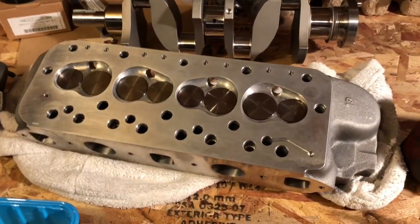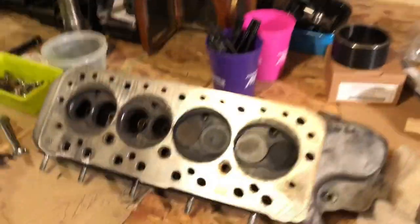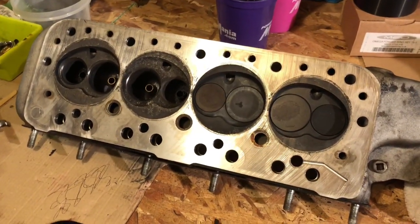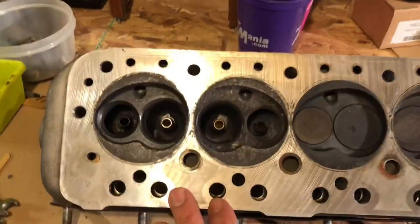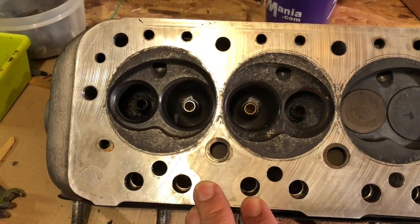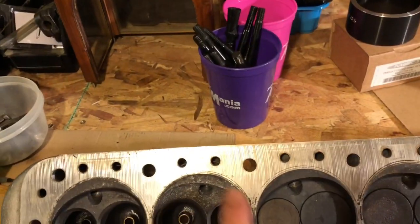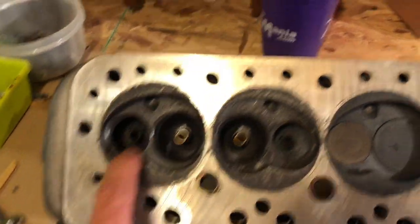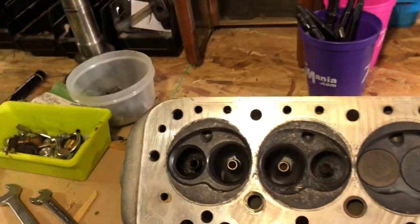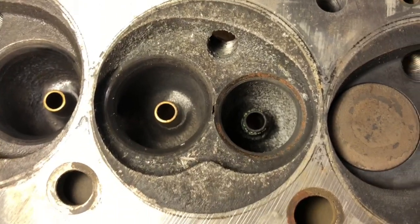Right here in front of us is the brand new Mini Spares aluminum head, the race version. We got one of the early versions of these to replace the very good Pierce head I built for this race engine a couple of years back. Unfortunately we had a trackside incident where something fell down the carbs, split itself into the two ports, and pummeled the chambers. The head was still working, but with bits and pieces flying around it took out material between the seats.